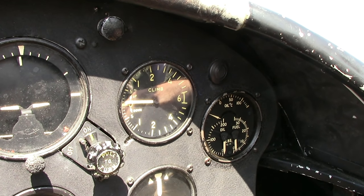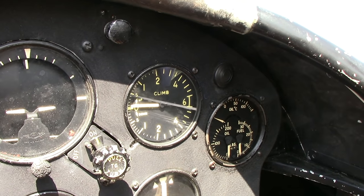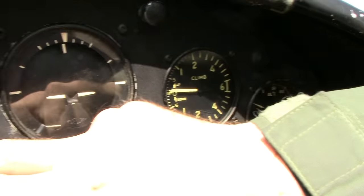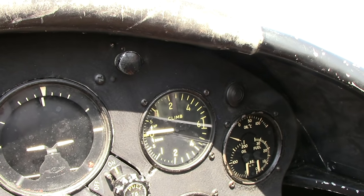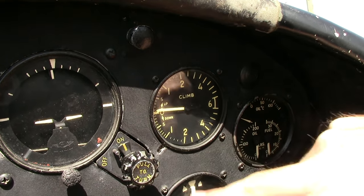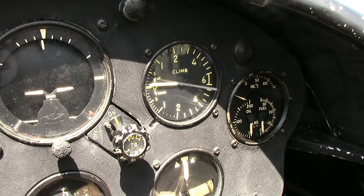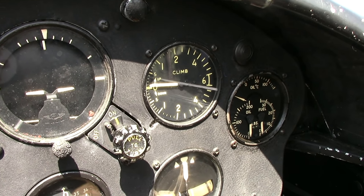So there's a static system on the sensor, which is under the right wing. And that senses a change in the flow of the air over it, rather than the air into it, which would be the airspeed. The flow of air over it and the static change of pressure that you get with the change of direction of air registers on this as a higher or lower pressure, basically. So if you were to pitch up, wherever the hole is, it would sense a change in that pressure, either higher or lower from where it should be. And it senses that and gives you a rate.